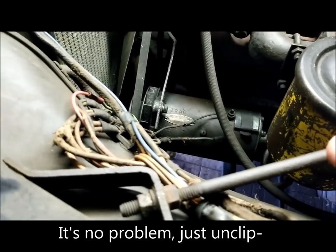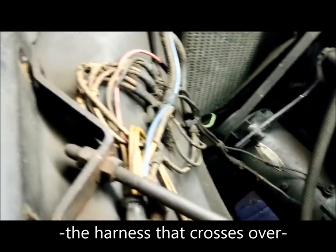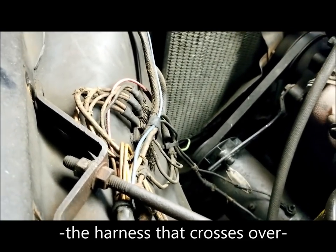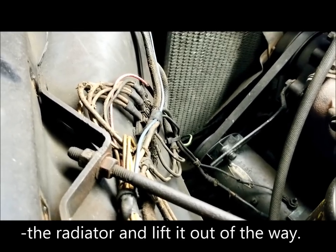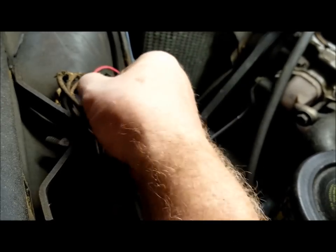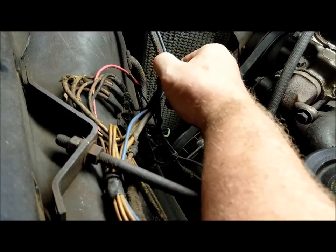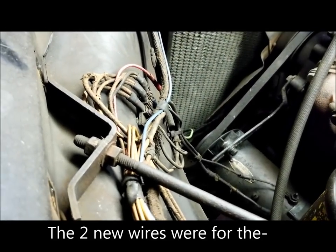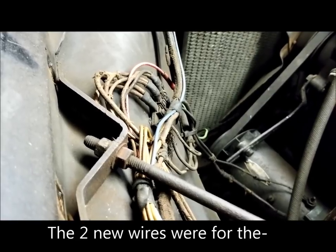I added turn signals to this truck to make it safe to drive on these modern roads, and brake lights on both sides. Anyway, I've got two wires that I'm going to cut, and I'm going to have to resplice in order to put them back together. Now, what I'm going to do is put plug-in connectors on them,